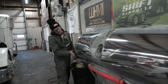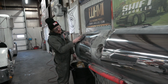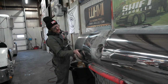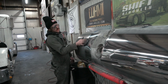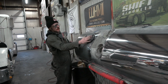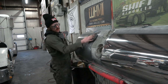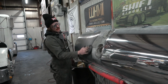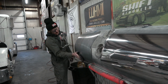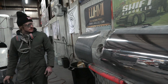And then I think I got your white and show brown set up ready to roll. The first time you were showing me this, putting the hand polish on lightly was also trying to break that start and stop line I've got going, where we're not picking up any of that compound in the middle, but the edges as well along the bottom, like where I'm going to start. Yep, you were telling me to break that line at the top and bottom. Yeah, because the rouge will actually spray off behind, and you don't want to pick that up in your next buff because then you're putting that 380 grit into your next buff.